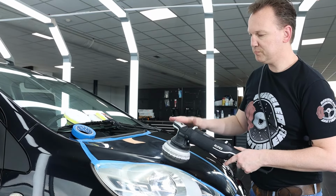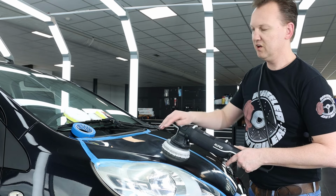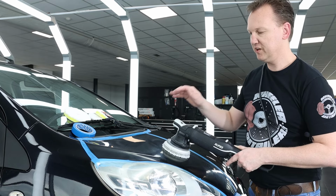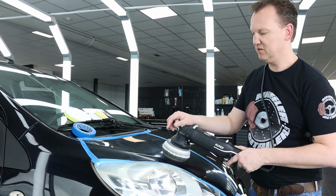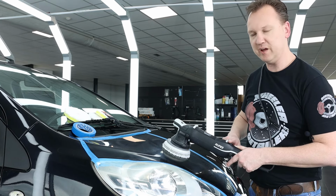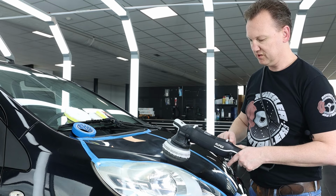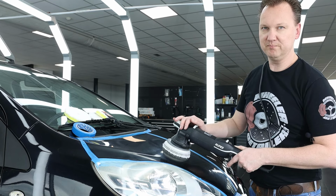When polish is evenly spread over the surface, I'm going to work on the Menzerna 400 polish until this film layer shimmer is as dry as possible. And with an orbital movement, with a slow arm speed, and on setting 5 on the polisher, it will probably take me 6 to 8 movements to have it clear.